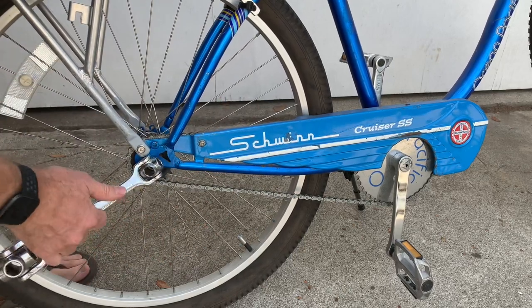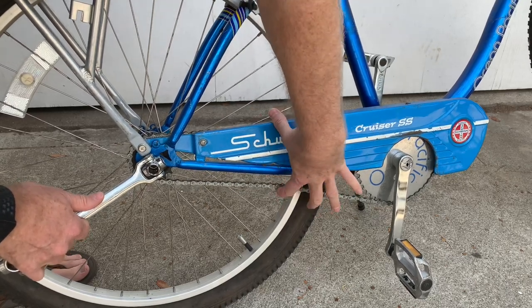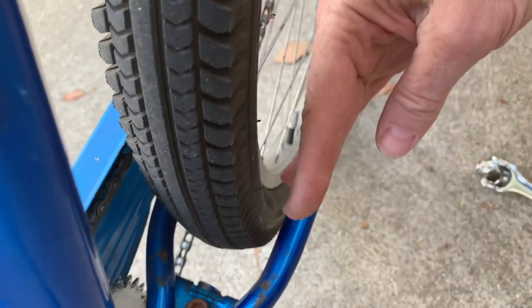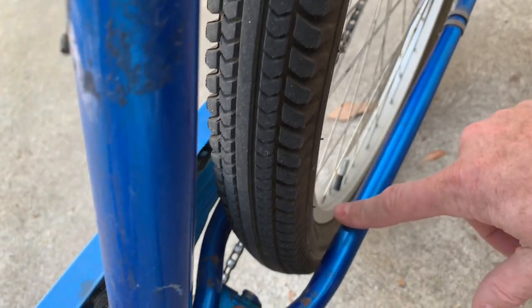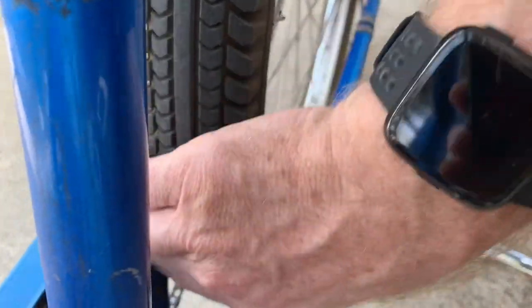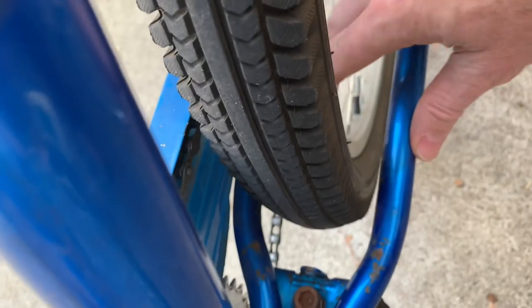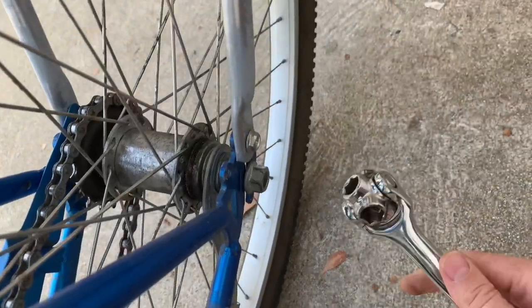You might have to make a couple of attempts, so tighten this bolt semi-tight while there's a little bit of play. While you do this you'll notice that you can get your wheel crooked so that your bike goes sideways and the wheel rubs against the frame if you don't do this right. After you've tightened up one end and gotten the chain where you want it, move the wheel back and forth and make sure there's an equal distance between the wheel and the frame on both sides, so that there's clearance, then tighten up that nut with your wrench.